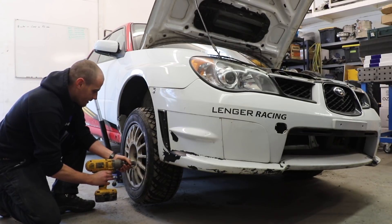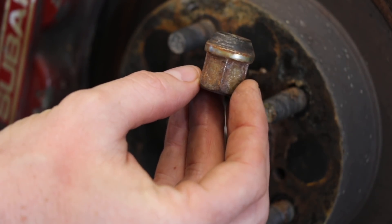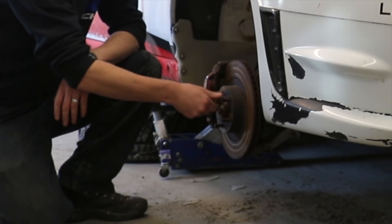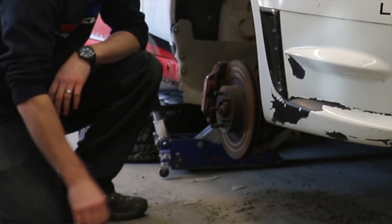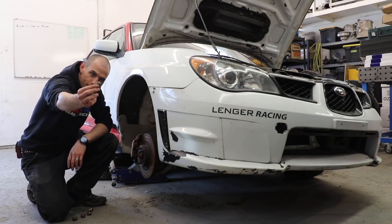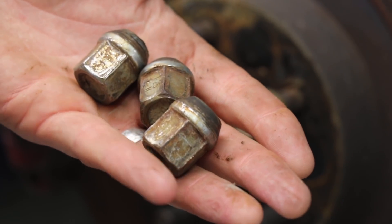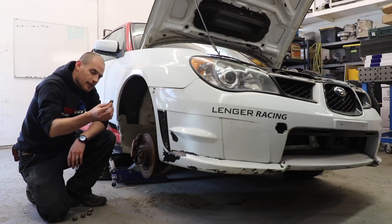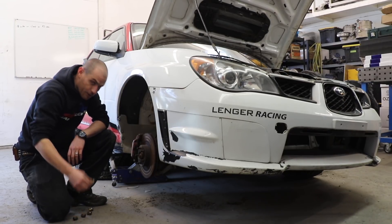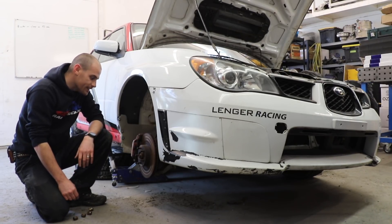So that's what lug nuts are going to look like. These have some kind of copper slip lubricant on them. The idea with the lug nuts, just like I'm sure everybody knows, is to hold the wheel on. But again, there's a specific taper to them. The nice thing about that taper is when you get wheels, you can get different lug nuts. It's a lot easier to find different tapered lug nuts than different tapered wheel bolts with different threads, thread pitches, and sizes and all of that stuff.